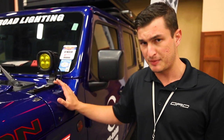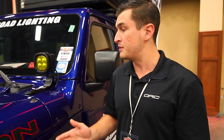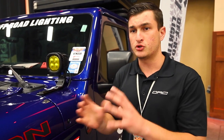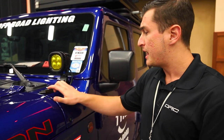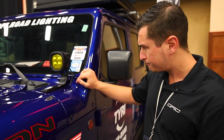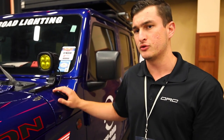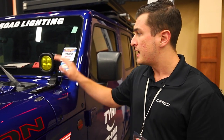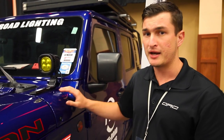That's important because the Jeep substructure, especially on the JL, is a lot of aluminum. A lot of companies will use steel bolts, and that's a big issue because when you have steel bolts — especially untreated — going into aluminum substructure, you get differential metal premature rusting which weakens just about everything. So: anodized machined bracket, anodized bolts, and these lights also have a vibration isolator that makes life on the light a little easier especially on rough terrain or high-speed Baja stuff. Both our brackets, light, and everything else involved has a lifetime warranty — if anything fades, chips, breaks, or goes bad, it will be replaced.